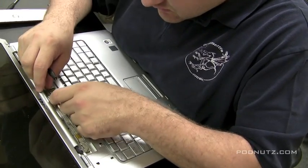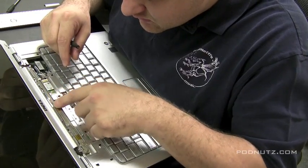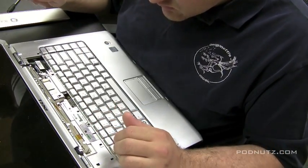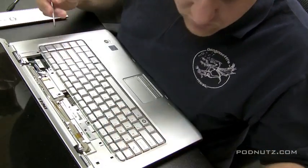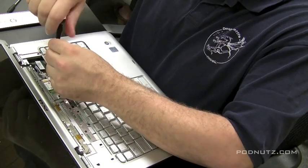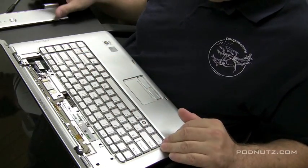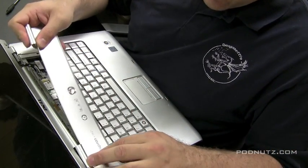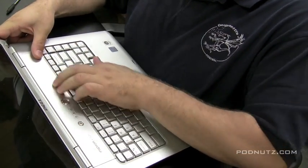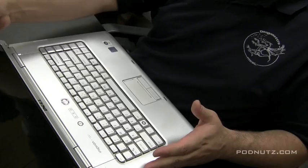Just making sure everything is flush the way it was when we took everything apart. That's the LCD cable in there — sometimes it likes to pop out from where it originally was and then the hinge cover plate doesn't sit exactly level like it did. Make sure the screws are tight. Take that hinge cover plate and snap it back in starting with the left-hand side on Dells and moving your way over to the right. Everything looks straight, keyboard looks like it's okay, and that's how you do a keyboard replacement on a Dell. See you next time.